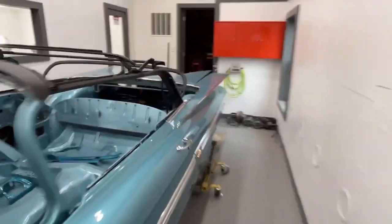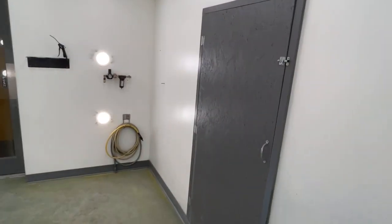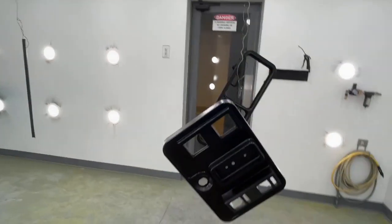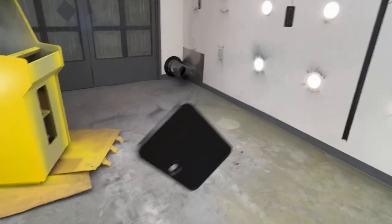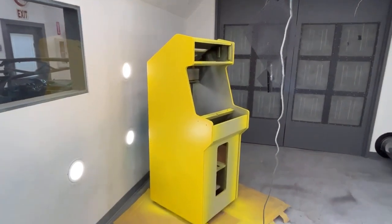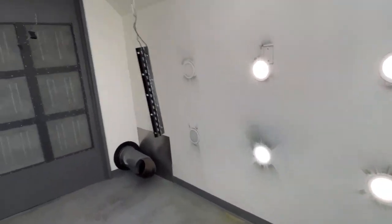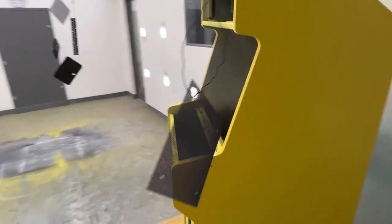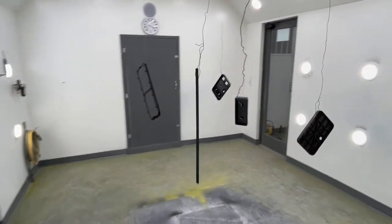It's a little hot in there, so I'm only going to be able to show them to you briefly. It's 130 degrees. So you can see how nice these turned out. Just has a slight texture. That's pretty much just how it looked when I sanded it. I did bring the cabinet back in here just to give it some more dry time tonight, because it'll stay warm in here for a couple hours before it starts cooling off in here. And that's what also helps paint dry quick, is to get it really hot and then to cool it off. It tends to harden it up nicely.